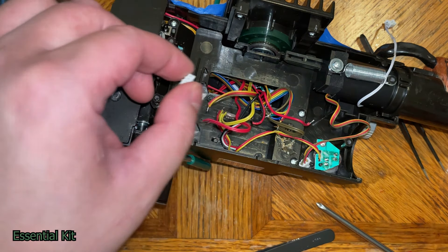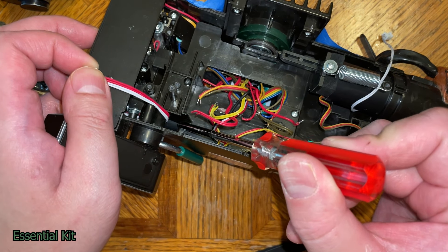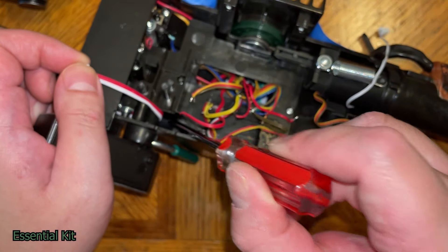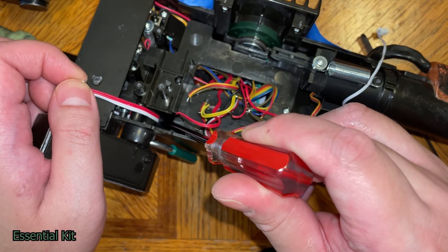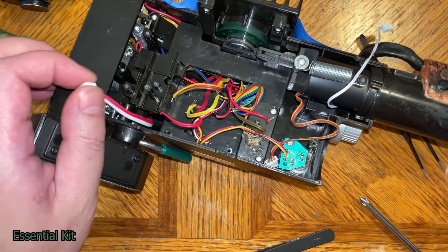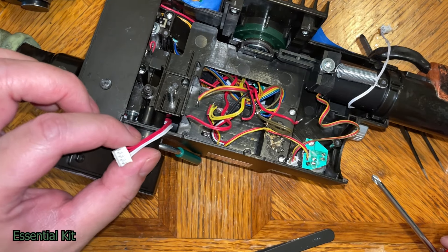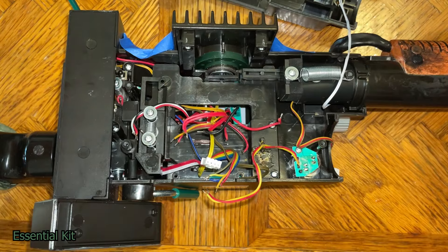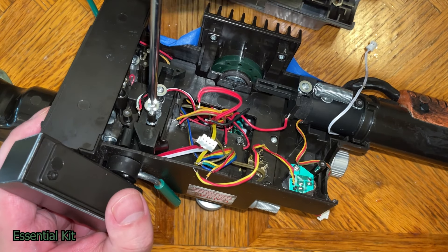Next, we're going to do some drilling. We need to drill a hole into the underside of the wand handle. First, move the cable out of the way so you don't accidentally nick the ends while drilling. The wire also needs to be longer to connect to the new board. The only way to move it is through the little gap between the parts. To access it, unscrew the spring mechanism, lift the spring up, and remove the piece at the bottom.